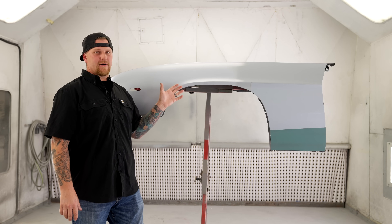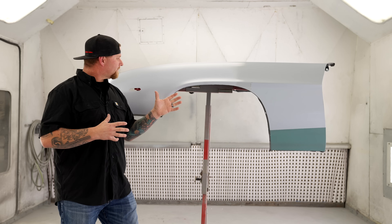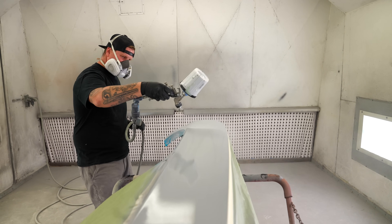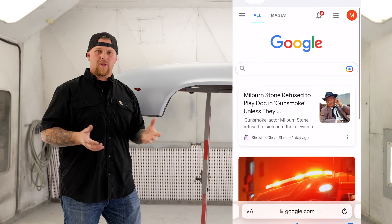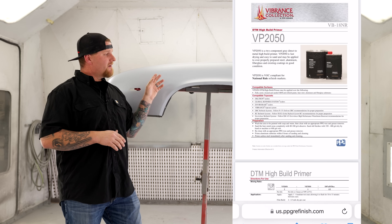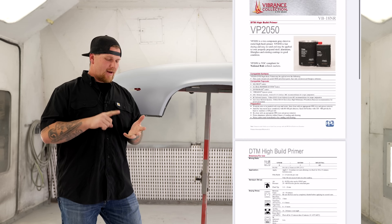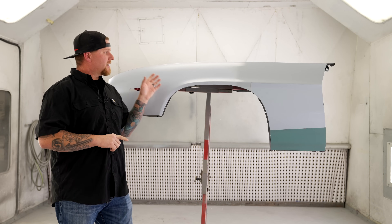It's always good to understand where these products are being used. A polyester can be sprayed directly over an epoxy primer — as long as you are within the recoat window. You need to be looking at your TDS sheet, which is a technical data sheet. If you Google the part number of your primer, you'll find a TDS that covers all the characteristics for any of these products, including pressures, recommended tip size, dry times, and flash times.